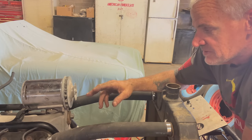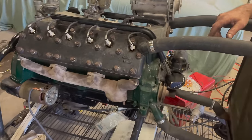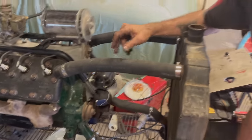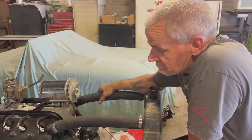And then I pulled the tops of the heads off. So you made sure the pistons were nice and loose. Heads were off, pistons were moving, and you took the pan off and made sure that was clean and everything was good. And went ahead and changed the oil pump? Yeah, put a high volume oil pump on it. Okay, and basically that's it.